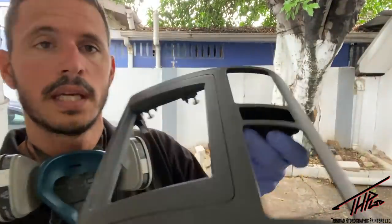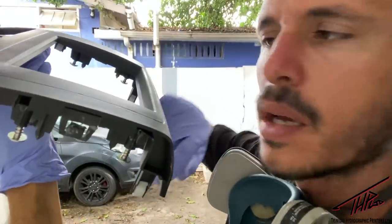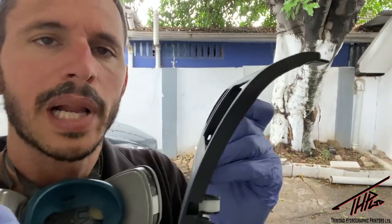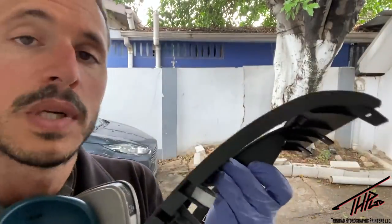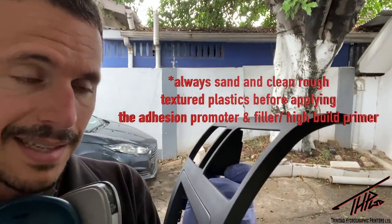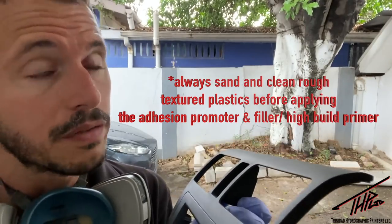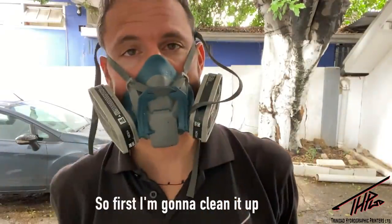Another part I'm going to do today is plastic. It's really slightly textured — you probably can't see it from here but I should be able to just sand it down smooth with either a 320 grit or a 400 grit. Clean it and then I'm going to apply plastic adhesion promoter before I paint it. But if it was a rough texture and I wanted it smooth, I would use the adhesion promoter for plastics and then a filler primer, wait for that to dry and then sand it smooth. Thankfully the texture on this isn't too bad so I'm going to skip the filler primer step.